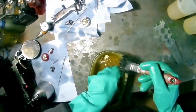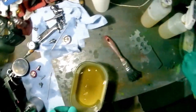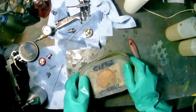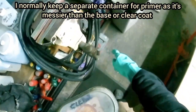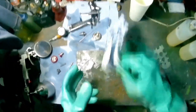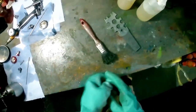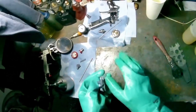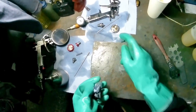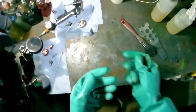We've done that - now it's just a matter of leaving it to evaporate. Brush off, put the lid back on the thinners container - that's good for about 20 cleans depending on how much paint was in the gun. When the thinners is finished, I put it in a tin and take it to fires we have at the fisheries I'm a member of, but if not take it to your local recycling centre. Then we put the gun together and wipe it over with a cloth wetted with thinners - it just puts the shine back on the gun.